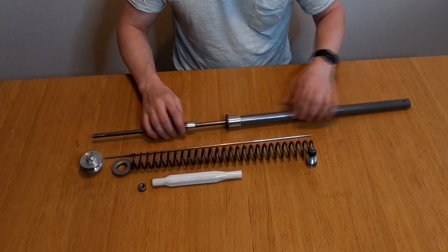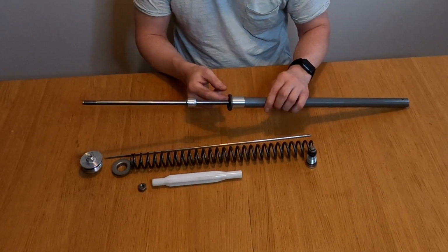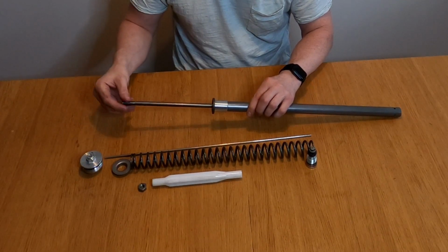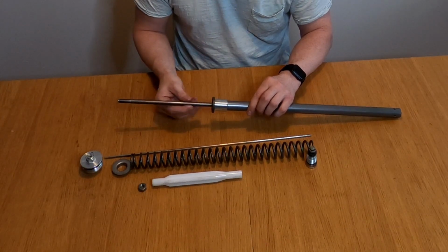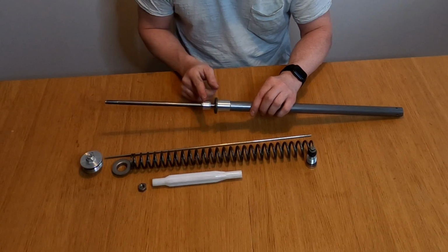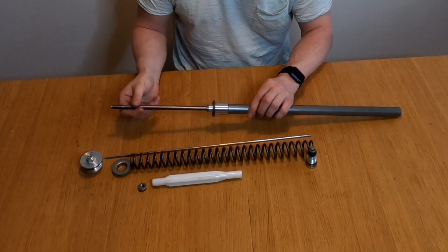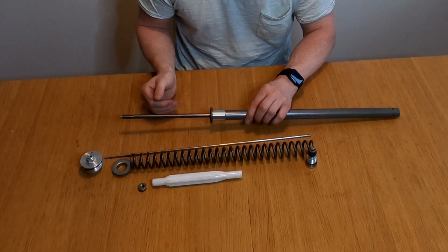We also have a hydraulic end stop, which is this part. It goes into a seat here, so when your suspension is fully pushed together and you have reached your end, this is what hits everything. This hydraulic end stop forces oil out around it. So when you get closer and closer to the end, it will get a bit tougher for this to move down. You will have like a tiny oil cushion down there.